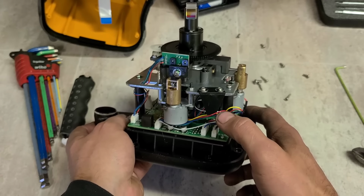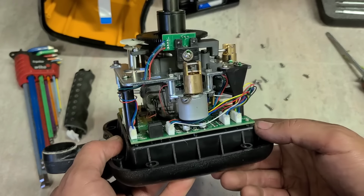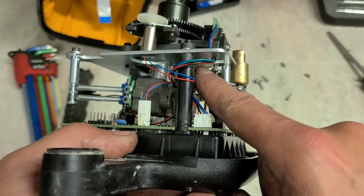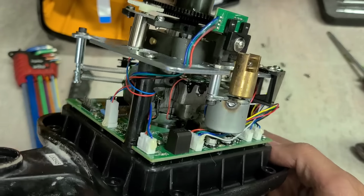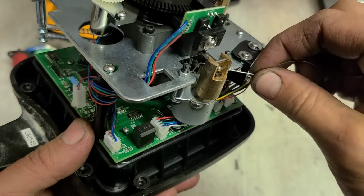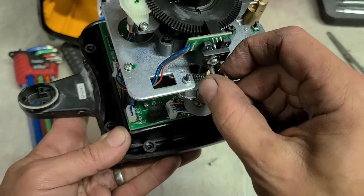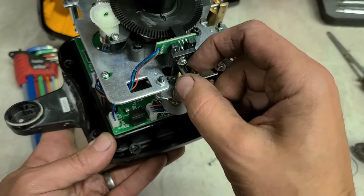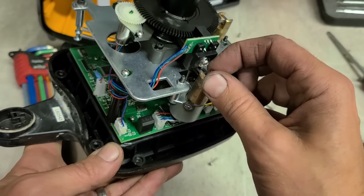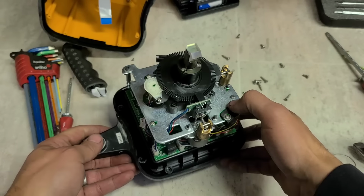We're not going to know now until we switch her on, see if she runs. The little thing you need to do is reconnect this tiny little spring. The spring is just to keep this wee brass nut forced around here, stops it from spinning the opposite direction. That's what the bar is for, and this second bar has to stop this, make sure it doesn't go around any further. That should do the job.